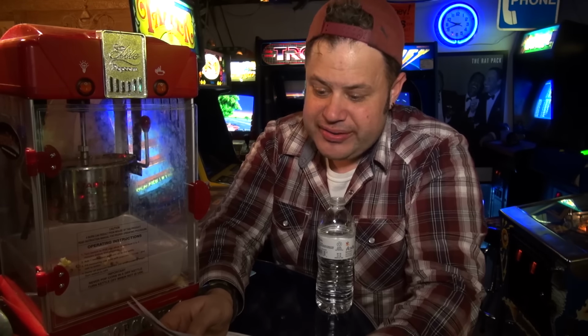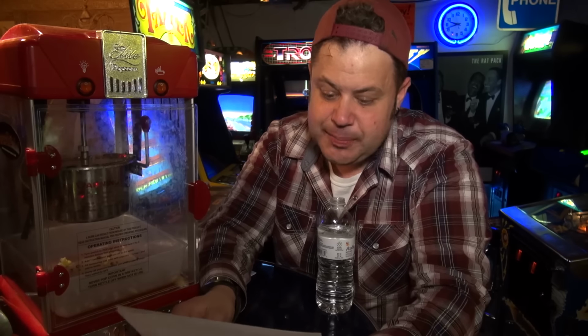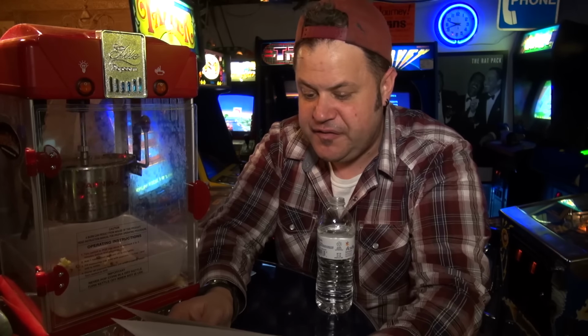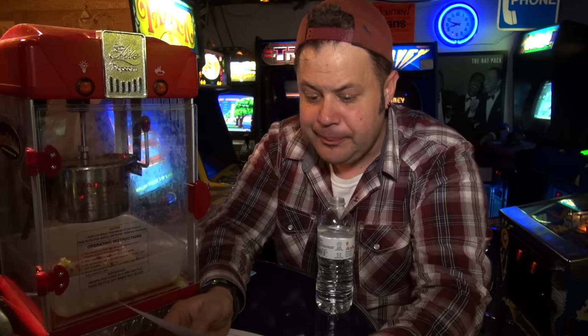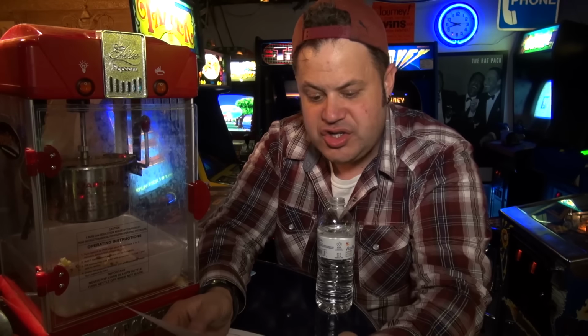He says, I too, as I'm sure many others in the arcade community, have the same problem. A simple solution that I made a few years ago, I attached a couple of pics here of it. It's a mirror mounted on a flexible neck with a clip. It cost me about $15 at Walmart. It is well worth it. I made this from taking a flexible clip light, removing the light fixture, mounting a mirror in its place. You can clip the mirror anywhere on the cabinet or something nearby, and adjust the viewing angle with the flexible neck. That way you can watch as you turn pots. I use mine a lot and recommend having one.